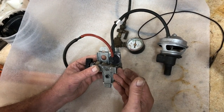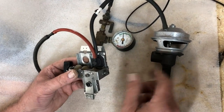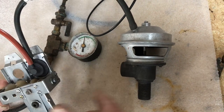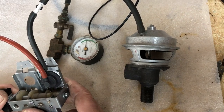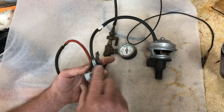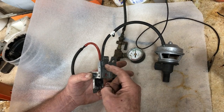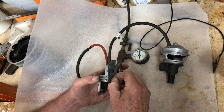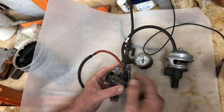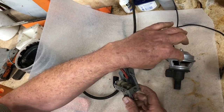This is the Clear Hooters vacuum operated control device, and what we're using here is an EGR valve. Typical of EGR valves, as you get close you can see it has a piston in it — and you can see that the piston just went up and goes down. What we're doing is confirming the operation of this valve, which is also controlled by a bimetallic switch. This bimetallic lever lifts and releases a needle valve that operates in this plunger device. The red here indicates the supply of vacuum and the black is going to our valve.